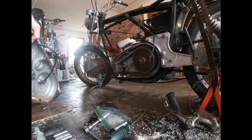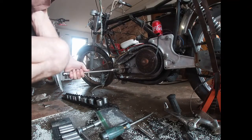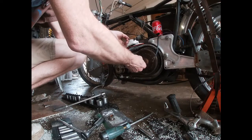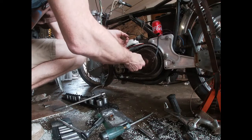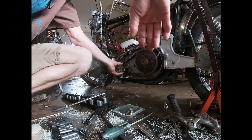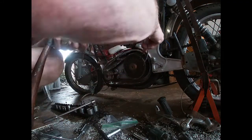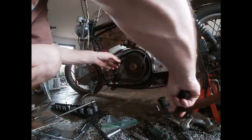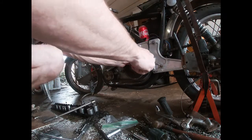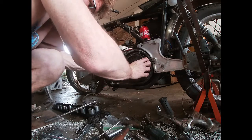Cover. This unscrews the regular way — threaded bolt with the washer behind it. Go get the book and see what I need to do to get these off, and if I need a puller or not. There's a little circlip here — I just grabbed it and popped it. Hopefully she'll come out pretty easy after that. There's a push rod in there too.